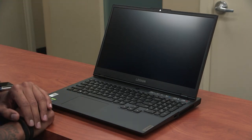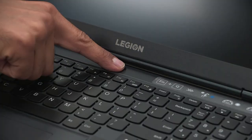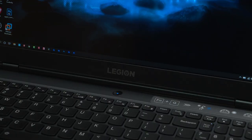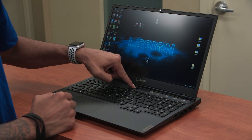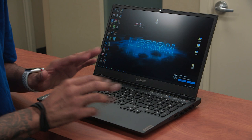Look at that beautiful display. Now the power button on the Legion 5i is actually located at the top of the keyboard. One of the cool things about the power button is that it is actually an indicator of your thermal mode. You can use the function Q key to cycle through three modes. By default it goes to blue, which means quiet mode. Click function Q again and it will change to white, which is balance mode. Hit function Q once more and it should change to red, which is performance mode. I did have some issues with that — I will go over that pretty soon.